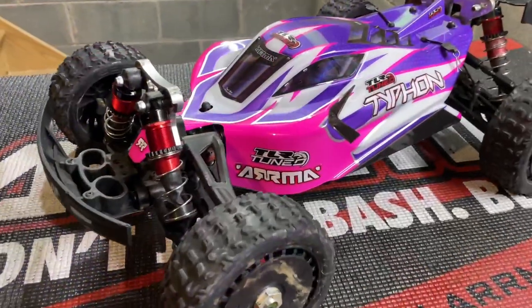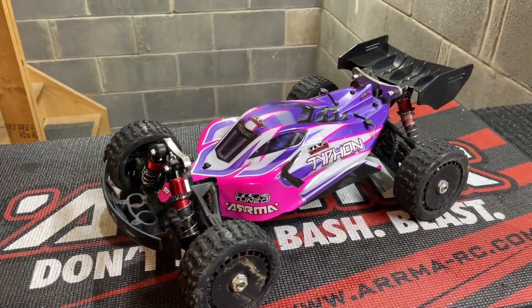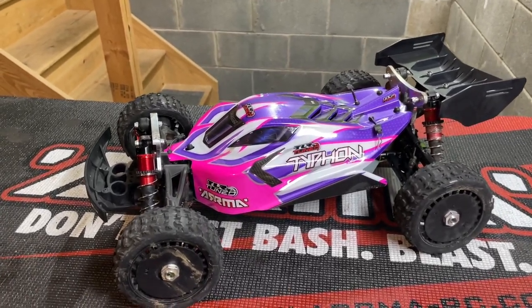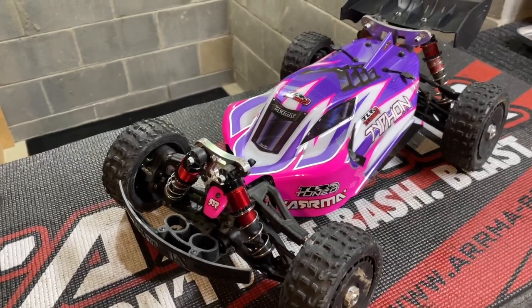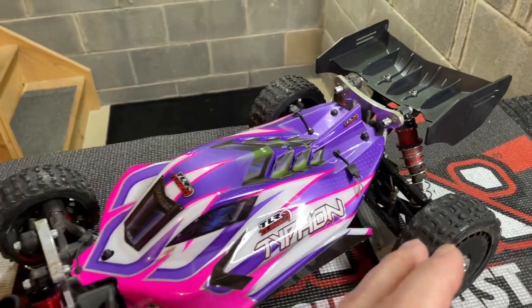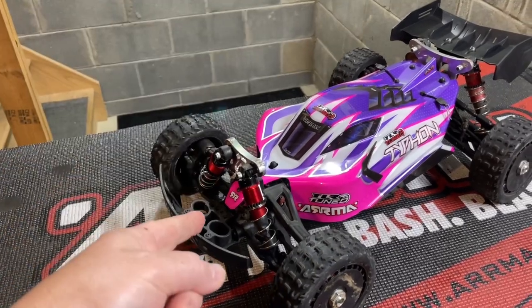The first part we're going to talk about is noises and where they're coming from, because depending on whether you're on the throttle or on the brake, that's going to tell you where the problem is. If you're hearing a really bad clicking or grinding noise when you're on the throttle hitting the gas, 99% of the time it's going to be your rear differential. If you're hearing a nasty clicking noise whenever you hit the brake, it's going to be in your front differential.